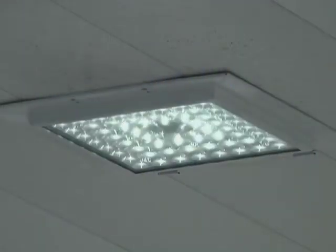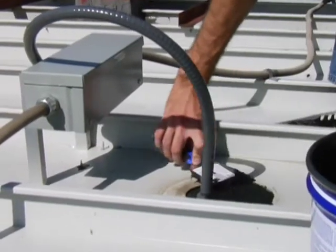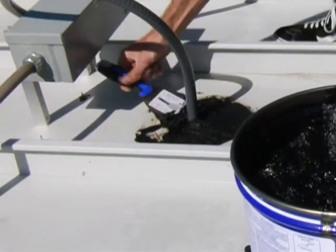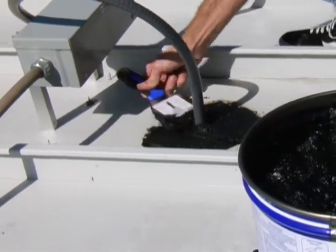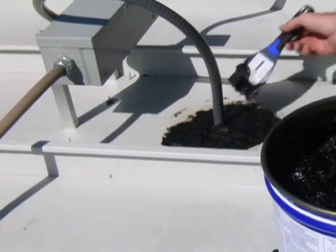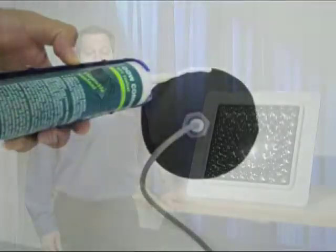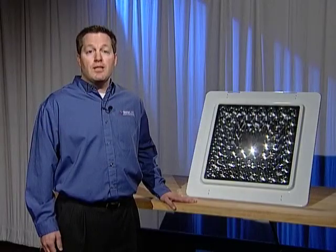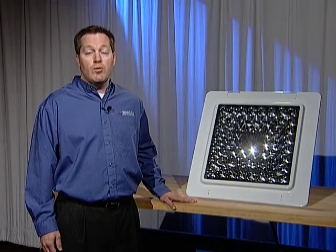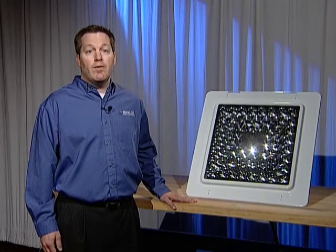This is a good time to test the lights before sealing up the penetrations. Step 5: Using a putty knife, spread the roof tar on the openings in the canopy skin, including the hole for the wire pass through and the six screws for the hanger bracket and light. A silicone sealant can be used instead if desired. For large openings, it is recommended to use reinforced roofing fabric. Thread down the provided nuts until they are finger tight.